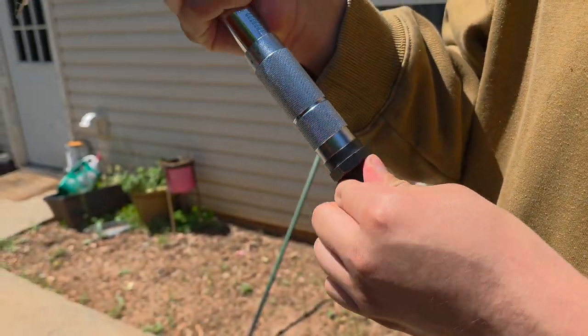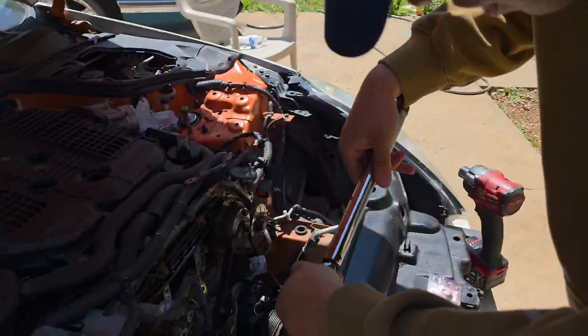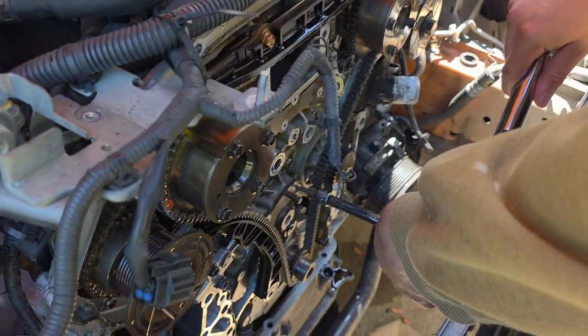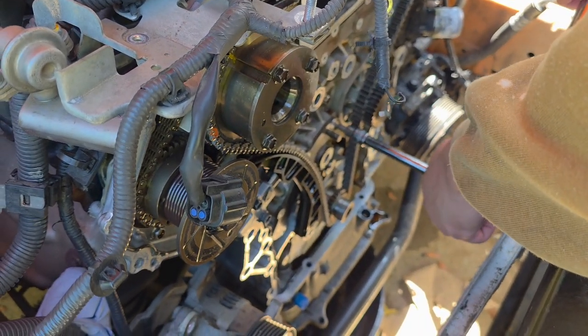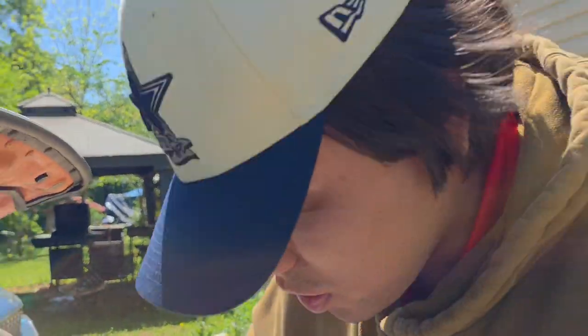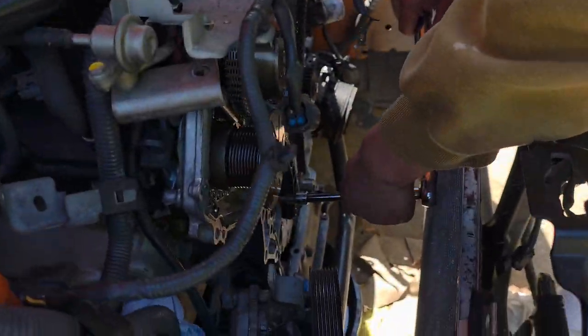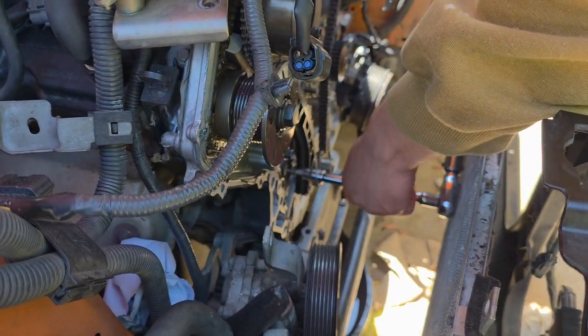Tighten it from the bottom. This is the one that broke. We don't need this. Then you just come here and you just torque it. Make sure you don't strip it. Make sure it goes in all the way. Boom. Just like that. They're all torqued. Let me check that this one's torqued too. Just because, I mean, we know we torqued them all, but boom, that's it. See, they're all torqued. All of them are torqued, and we use red Loctite.